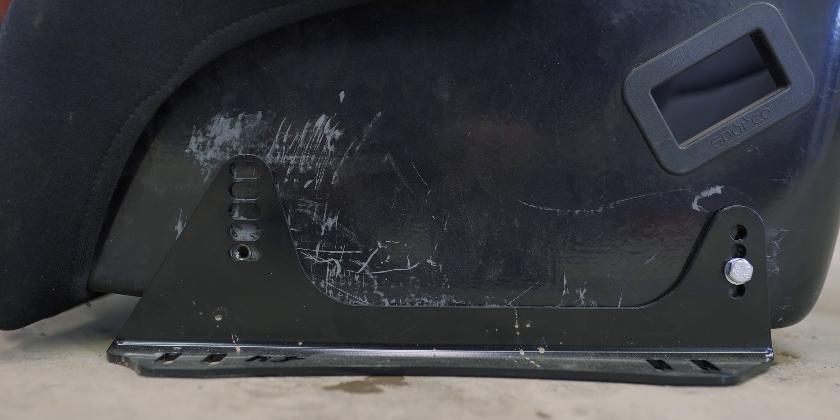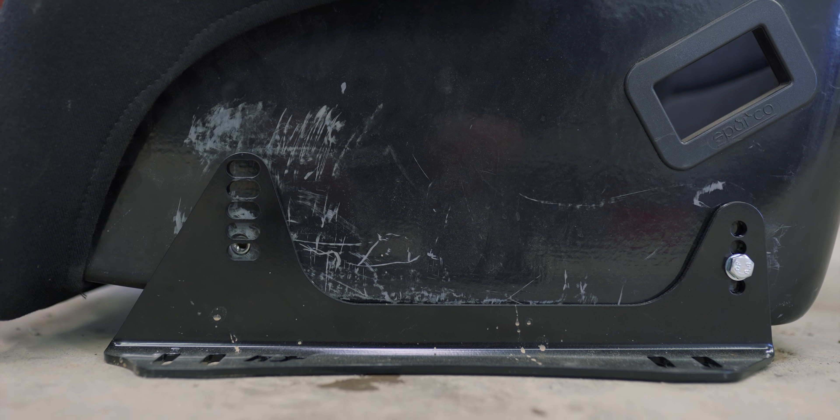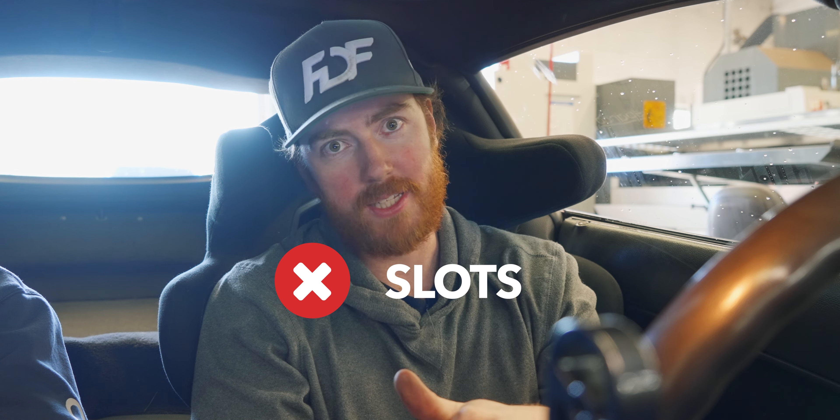Let me show you quickly how you can actually adjust the pitch of the seat and change its position within the seat bracket. There's no adjustment in the seat bracket itself other than pitch and height. All of your forward-to-back adjustments are done on the rails, because we don't want slots — we want holes for changing position, because we want that constraint for your safety. Thanks for watching, thanks for liking the video, thanks for subscribing. We're super busy right now, that's why it's been a bit slow, but we're getting the content out and trying to catch up. Thanks for all your support — see you in the next video.